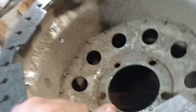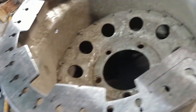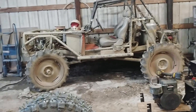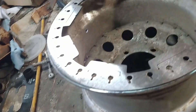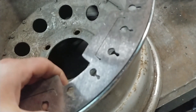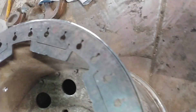I cheaped out when I ordered these beadlock rings — I just stayed with the basic 3/16 inch thickness. They had an option to go quarter inch, but I figured for what I'm doing here the 3/16 is fine. I've seen other videos where this brand of beadlocks had the beadlock fit down into the rim, and I expected that to happen but it didn't. I'm okay with that — I probably could have ground a little off to get it to fit, but I really wanted to get as much width as I could out of these.